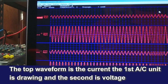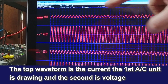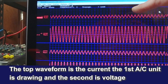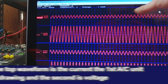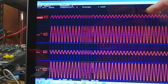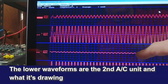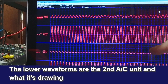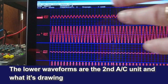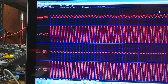You can see right now I've got both units running. The top reading is the current and the other is the voltage for the Truma unit — it's running around 12 to 14 amps at 120 volts. The lower display shows the current and voltage of my Dometic Penguin 2. These units are cycling on and off randomly, much as they would in your RV.